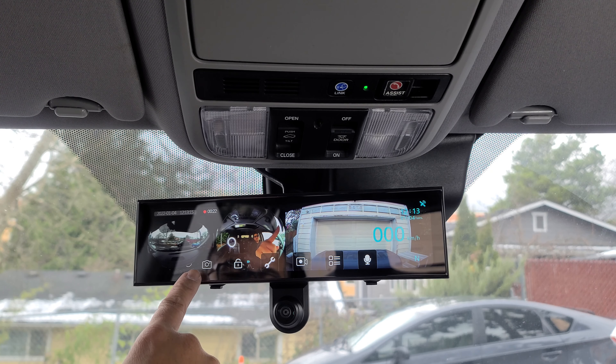Now I'm going to go ahead and clean up the wires — I got all the wires hidden, and it has that one wire cleaner look. Make sure you hide all your wires up here and not behind this A-pillar, because we don't want it to affect your airbag system.